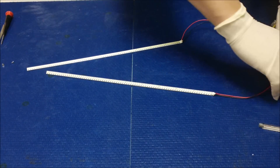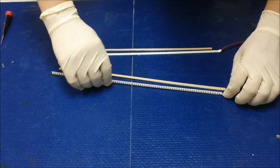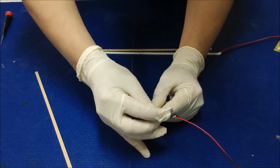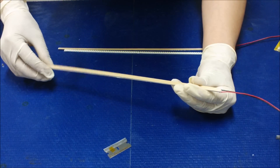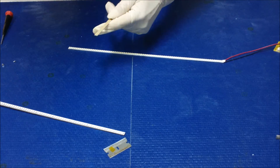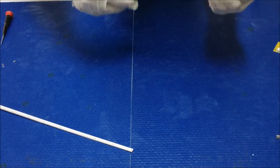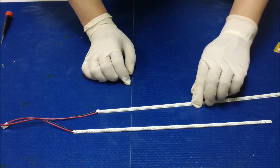Now the second step is to add aluminum foil on each of the LED strips. This end goes to either end like this, and then the other end sticks to the plastic film. Let's do one at a time — remove the double-sided tape. Stick it on top, making sure you have good contact. Do the same for the other one. Both are done — we've added the extra aluminum to the strips, and now it's ready to be installed.